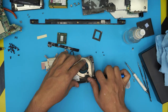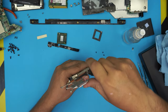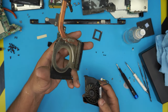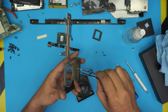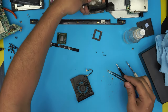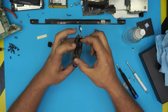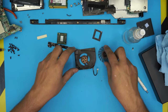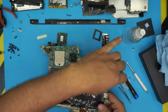Look at all the dirt inside — this is why it's not cooling down. Grab an old toothbrush and clean everything thoroughly — all the dust must go. Also clean the fan with a toothbrush. You can remove the fan by grabbing it evenly and pulling — wash it with a toothbrush and alcohol, clean the motor, and inject one or two drops of lubricant inside the pin area for better fan rotation.